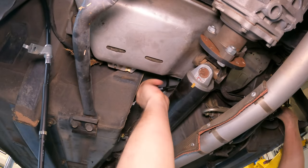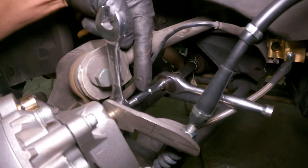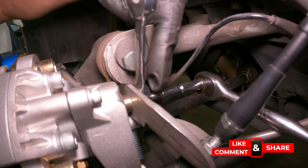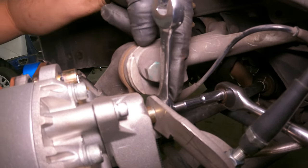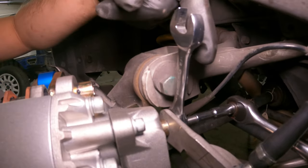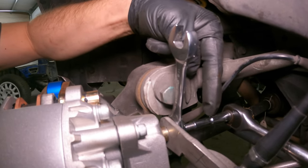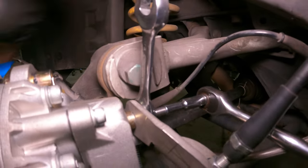I'm going to show you the last thing with these calipers, which is actually adjusting the caliper so that it works. I have my 6mm on the end of that stud — this is for the lock nut. What you've got to do is loosen the lock nut and tighten this down. You want to make sure the lock nut is loose enough that it doesn't stop, because if it stops you're going to think it's tight and it's not adjusted properly. So essentially just leave this on here, keep loosening the nut as this gets tighter. Once this stops with very little force — you're not cranking on this thing — you back it off one turn. Then you check the rotor, make sure it spins, and tighten down the lock nut. That will give us a well-set e-brake.